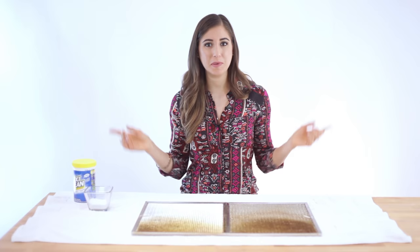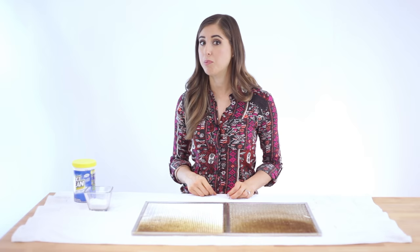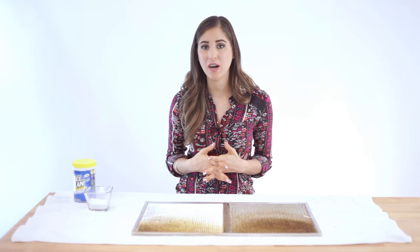There are many ways to accomplish getting the grease off these grates. I'm going to demonstrate one which I think is pretty awesome and then talk about a couple of other alternatives. I'll show you how to use OxyClean and hot water to clean the grates. If you have a degreasing product or an enzyme cleaner handy, that would work well too — heck you can even use dish soap, which is designed specifically to cut grease, but I figured we'll do it with OxyClean because variety is the spice of life.